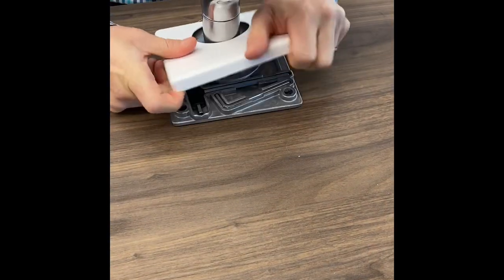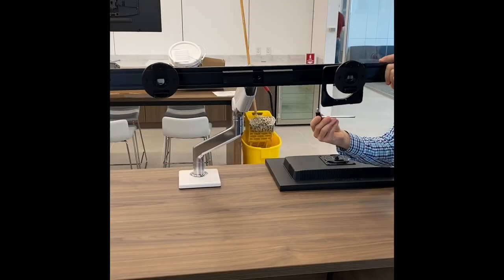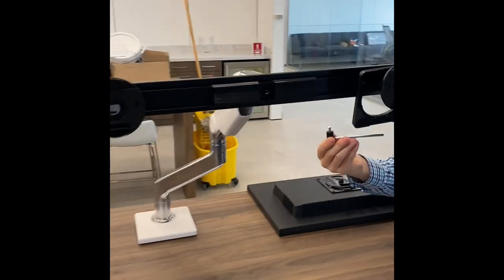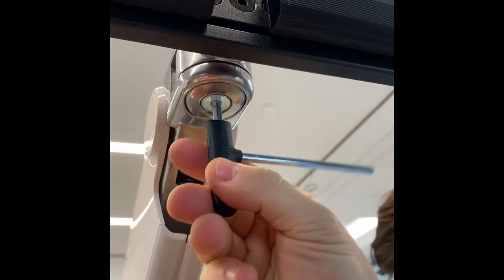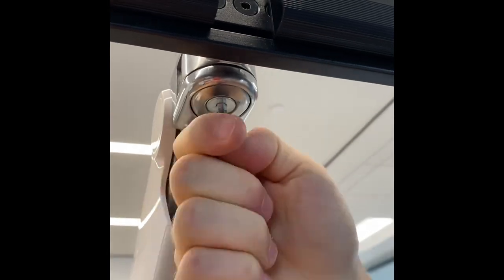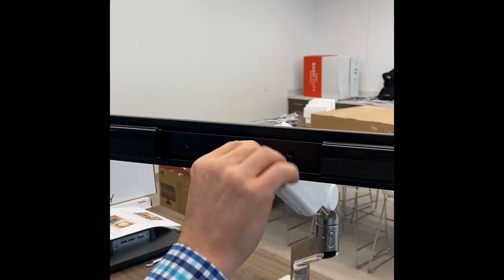The remaining steps will be completed using the tools located underneath the base plate of the monitor arm. To ensure the crossbar is secure and as level as possible, tighten the bolt that holds the crossbar connection point to the arm link using the larger of the two allen tools. Also ensure that the three screws that hold the crossbar to the connection point are tight and secure using the smaller of the two allen tools.